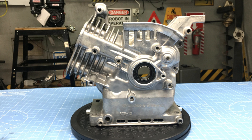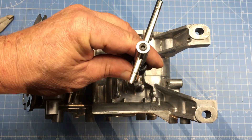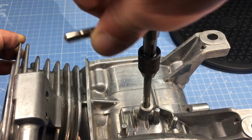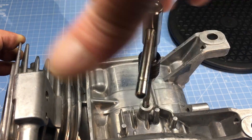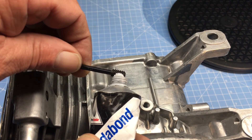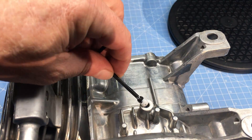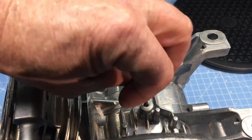We're starting off with a bare engine block — the same type of engine we've been using throughout the video series. It's a 212cc Predator that can be picked up for $99 when it's on sale. The first thing we're going to do is close up the holes left in the block when the governor was removed. On the top of the block we need to plug this hole with a ¼-by-20 set screw. The ¼-inch tap slots right into the block without pre-drilling — turn the tap down several turns but not all the way through, so the plug has something to thread into but is stopped from going through. I'm coating the screw with Honda Bond — the glue they use to put Honda motorcycle engines together. Some people like to use Loctite, and that's fine too.